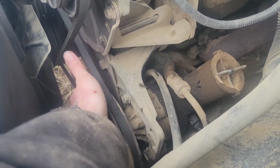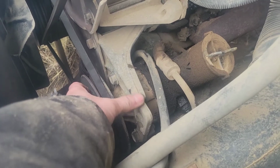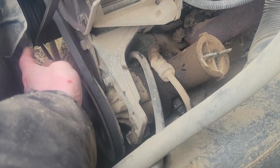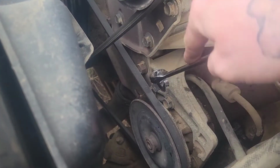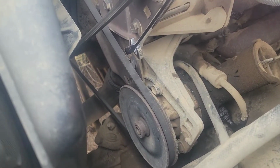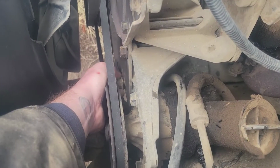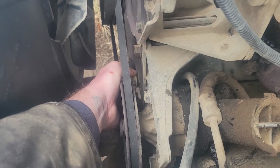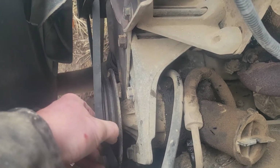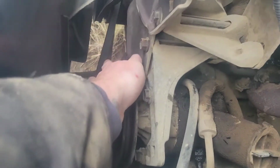I'm going to go ahead and loosen these two bolts just a tad bit so that this will rotate, and loosen up this belt, having to use the old two-wrench method to get those things popped loose. I'm sure they haven't been removed in a while. It's so nice once you get something loose enough to just use your fingers. Got that pushed down, and I'm able to get that belt off and out of the way now.